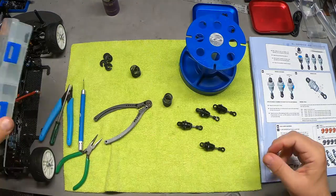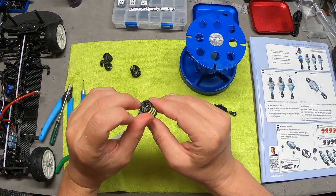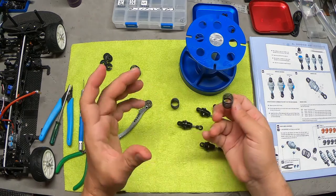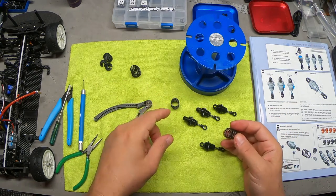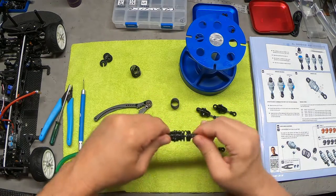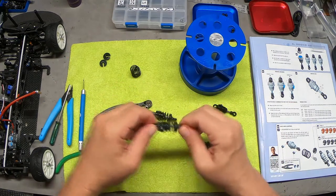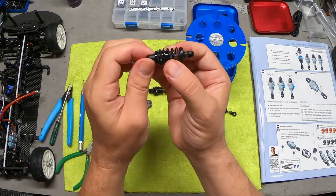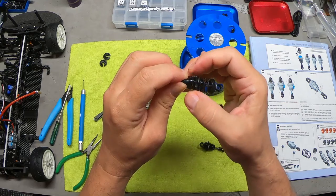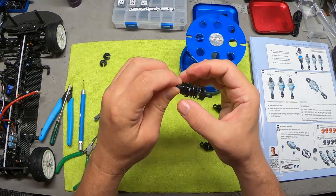This little box turned out to be the perfect size for these springs. And you'll see the numbers engraved on the top of the spring. In this case, you'll see 2.5-2.8. And so you know those are all the same, but still you want to know where to look for those. Okay, now all the springs are a little loose. You see that? So what we want to do is start by turning down our spring compressor until we get rid of that, and we'll just point it to one side.